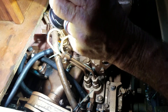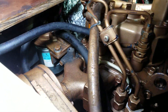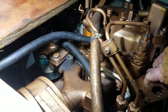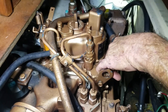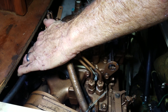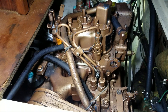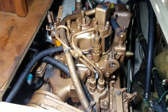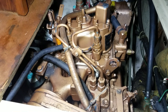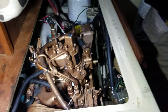This is the secondary fuel filter. The Racor is your primary. This does the work right here — if anything gets past that one, this one's here to keep the high pressure system clean. The injectors have to have clean fuel. Water won't even go through them — water will blow the tips off, because molecularly water is bigger and the holes are so fine.